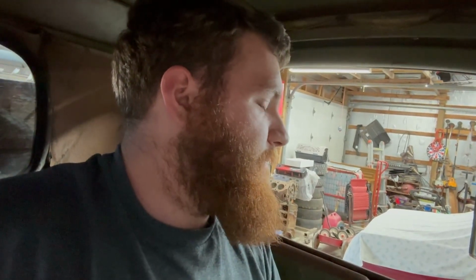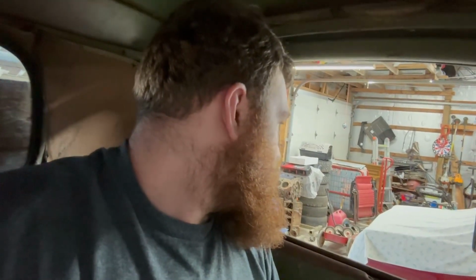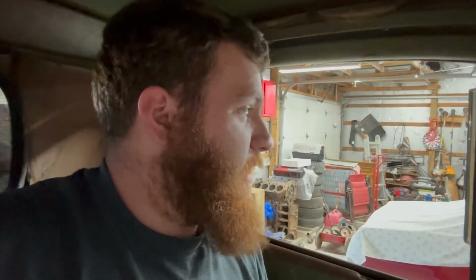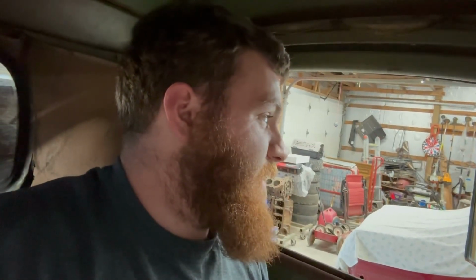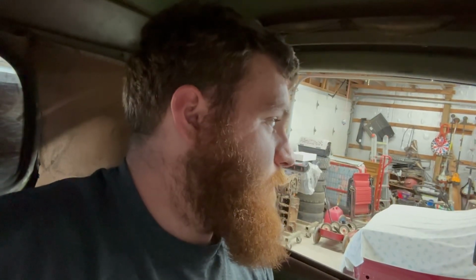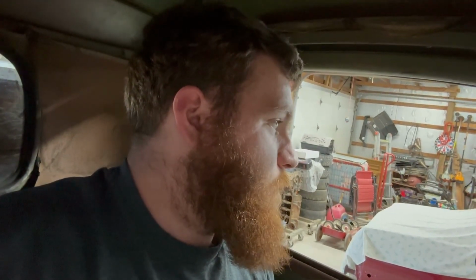We lost a wheel cylinder or two or three or four, so I'm afraid this is where we call it. For tonight. I really don't want to tear into those brakes. Nope. Time for wheel cylinders, sounds like. Figure out what's on the front. Let's not get any fluid in front. I guess it would be that the wheel cylinders are seized in the front.